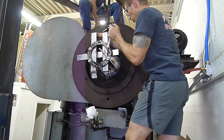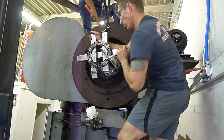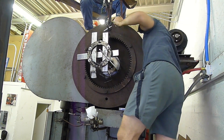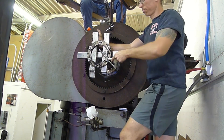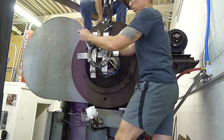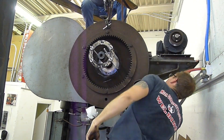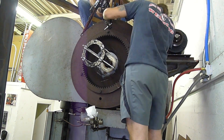As we watched this play out, sped up 4,000%, it actually came off pretty easily once it broke loose on that initial break. It just had to be pulled out about a foot before it was completely free of the shaft. The rear bearing actually stayed in place because the flywheel was so worn out that it wasn't even contacting that rear bearing. So the people that pressed the bearings back in just had to bore it out, put a sleeve in there, and then they pressed that bearing into that sleeve. But overall, this little puller here worked pretty well. The puller that is kind of designed for this sort of thing was multi-thousands of dollars, and this was just some stuff I had lying around. So that was almost the ideal situation.